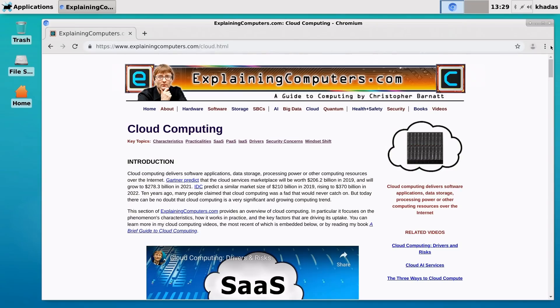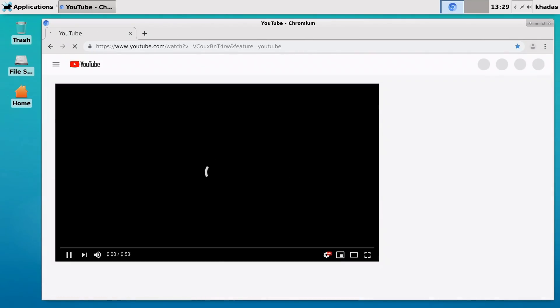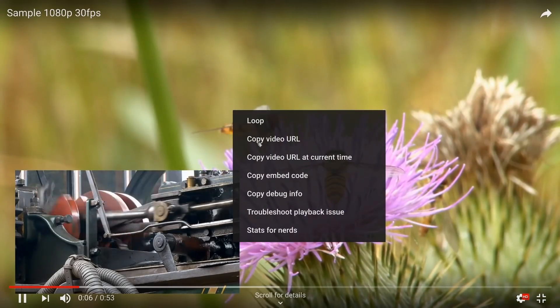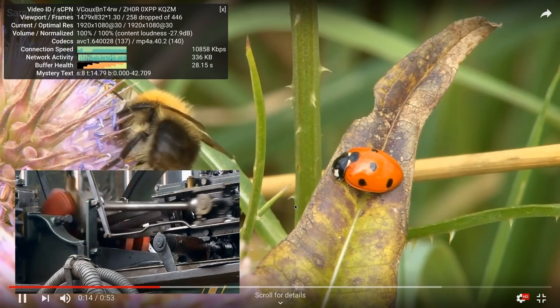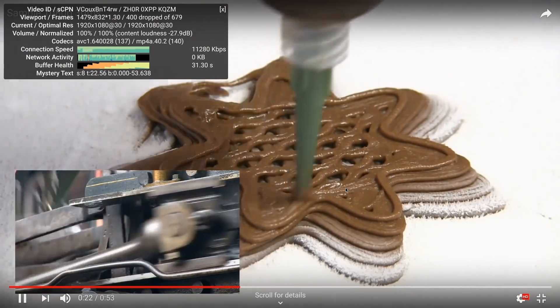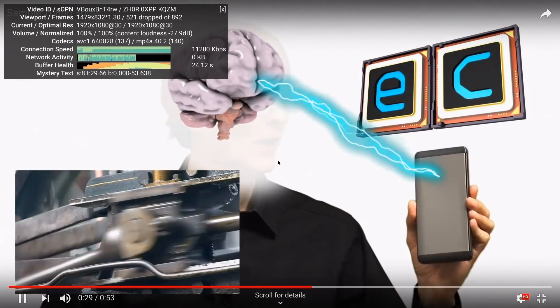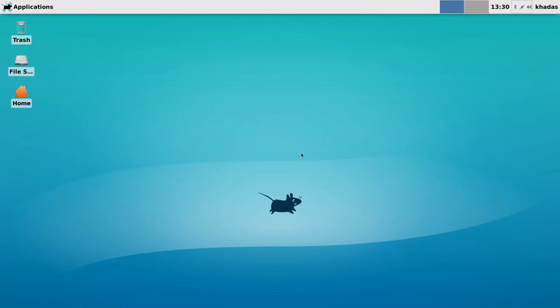It's probably worth going to YouTube as well. There's my sample clip — we'll just play that up. We'll bring up stats for nerds. It's not as responsive as it was in Android, and playing 1080p we are getting dropped frames. As is so frequently the case on single board computers, we don't have the best browser-based video playback — I'm sure there isn't the appropriate GPU support. If you want to play video on Linux on the VIM3, my strong advice is to use Android, where it works very well indeed, even at 4K.